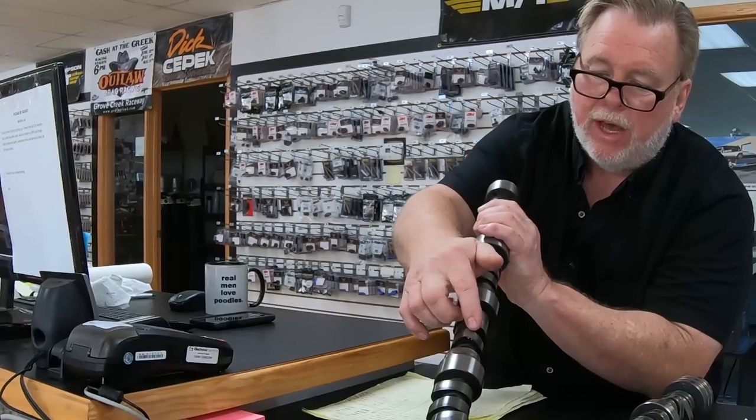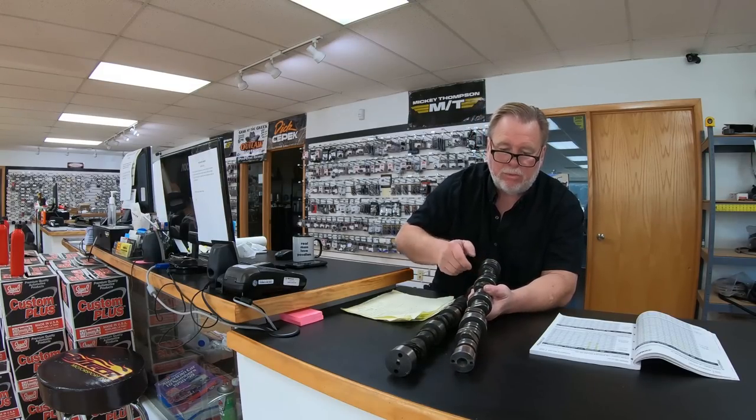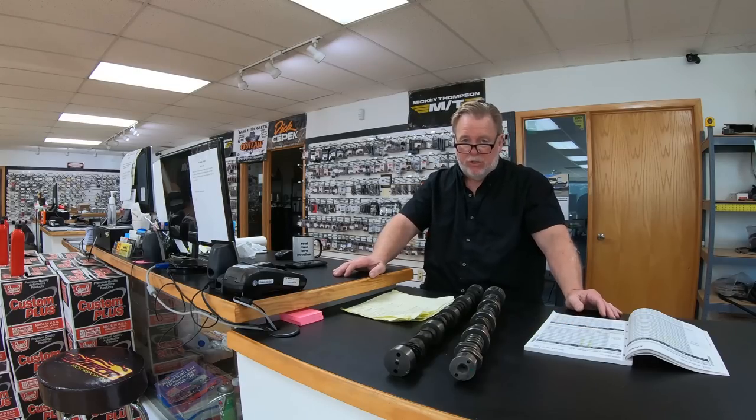Now we get to the meat and potatoes of why this works. Your roller cam configuration — I'll hold these up here. This is a flat tappet cam: see how it's pear-shaped? The lobe comes up very soft and there's not a lot of duration at the very top where your valve is flowing the most. Here's a stock roller cam — see how this lobe is very aggressive going up? That's because you've got roller lifters. With roller lifters from Comp Cams, you can have a short duration cam that still fills the cylinder head and cylinder to maximum, with a fat torque curve, good idle, and maximum cubic inch utilization.